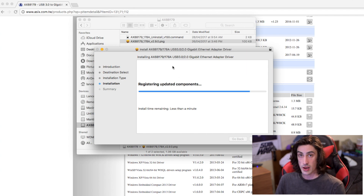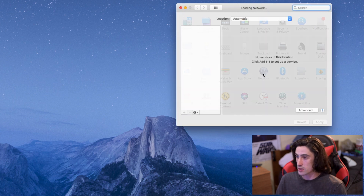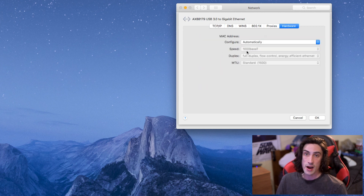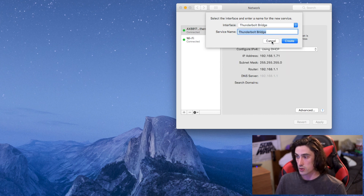Back up after restart, I also ran a Blackmagic speed test on the drive. In System Preferences > Network, we can now see the Ethernet driver listed. Going to Advanced > Hardware confirms we're running at 1000Base-T — gigabit speed. Under Add an Interface we can see 'AX88179 USB 3.0 to Gigabit Ethernet', confirming it's working correctly.